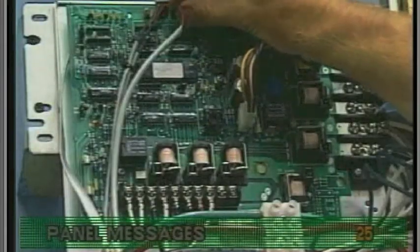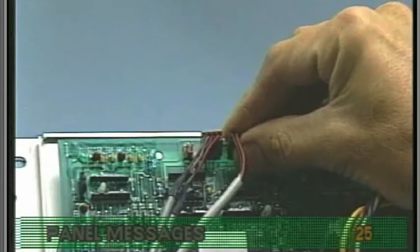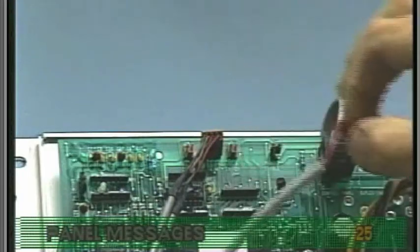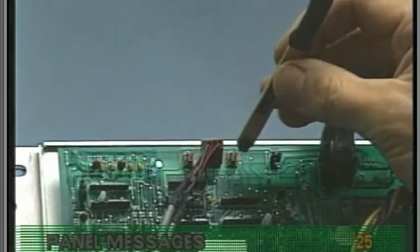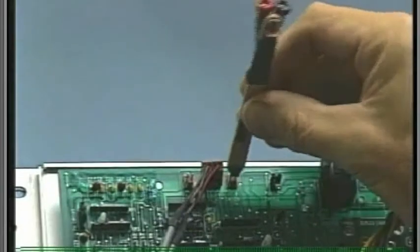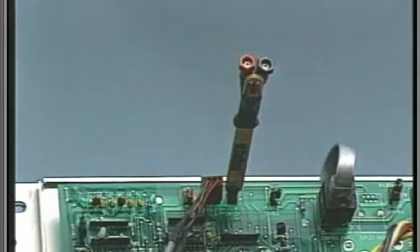If the pump is running and the plumbing is free of obstructions, remove the pressure switch wire from the circuit board and short the two leads on the circuit board using the Balboa logic jumper on a stick — we call it the LJS. Now wait five seconds. If the flow message disappears after the five seconds, you may find that there are cracks or cuts along the pressure switch wires.